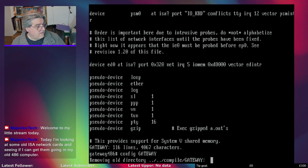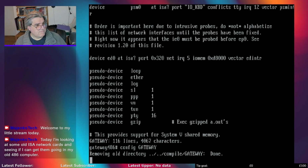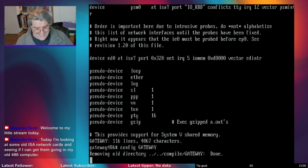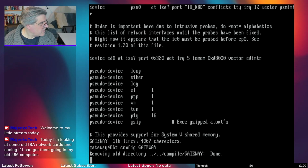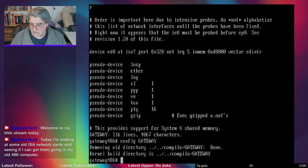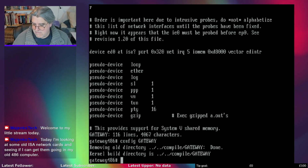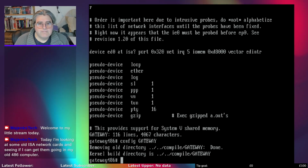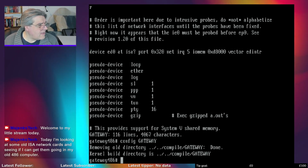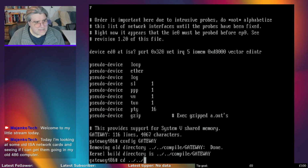So I think it's of more value in my games computer. Cyrix 6x86 games computer. It's got a wonderful ring to it, hasn't it? Yes, it's 166 megahertz, or it's called the 166 plus, so it's actually a 133 megahertz, I think. Wonderful chip, the 6x86. Released about the same time as the Pentium, with similar running speeds, but lacking the extra instructions the Pentium has. So it's more like a supercharged 486 than a Pentium.